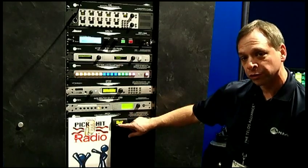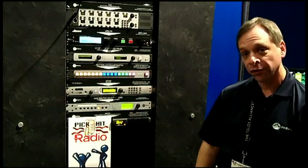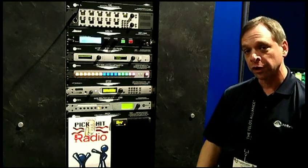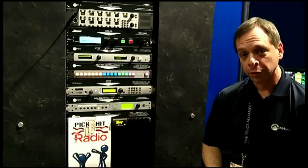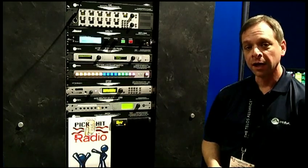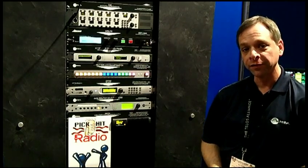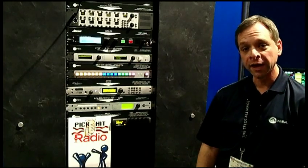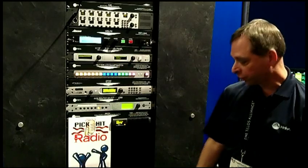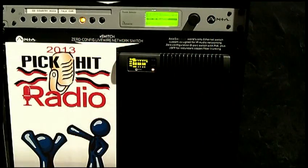This screen shows you exactly what's happening with your ports. First, the two gigabit ports on the far left also have SFP capability, so you can run gigabit copper or fiber — or both copper for redundant links. It's auto-sensing and will automatically fail over if a network cable is kicked out, with no data loss.